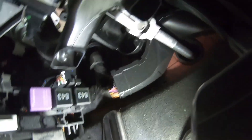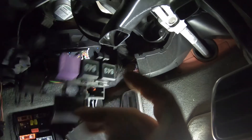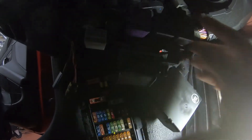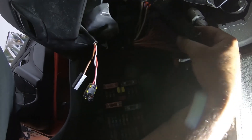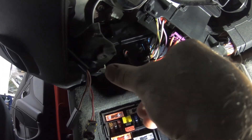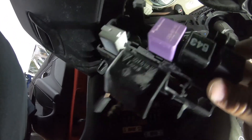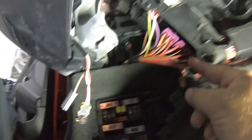Let's get some light in here. You can see these are just hanging right now — that's how you get to the service part of it. These are the two fuses for both the radiators. I was able to jump them. If you ever need to, you can jump them from underneath. If you jump it from underneath, you can jump these prongs right here. I was able to get it started by jumping the signal wire on this one and both fans turned on — so that was a good thing. You could also check power going to it. A lot of the diagnostics can be done from right here.